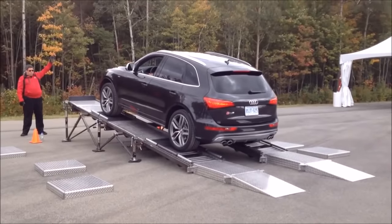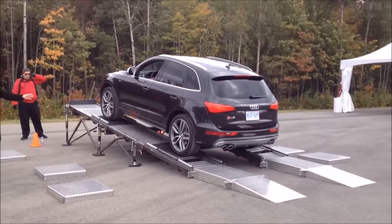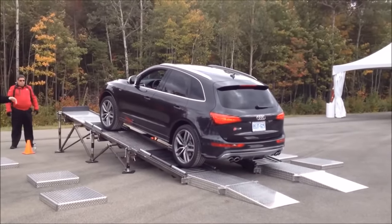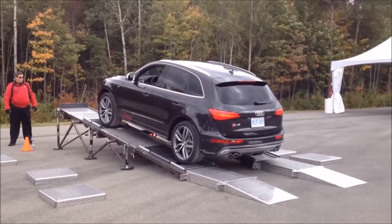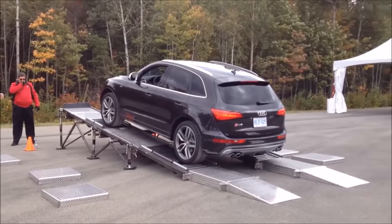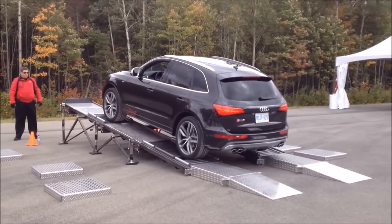Stop. Ease the brakes back. We're going to try and get the rear tire in the divot. You got about a foot. Okay. So now in theory, the rears are really going to spin just like before, but now we've got a liability here where the diff in front, it's an open differential. There are no clutch packs there, so it's going to be EDL on either side that determines where the torque goes. Go ahead.